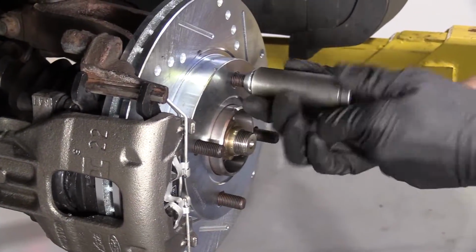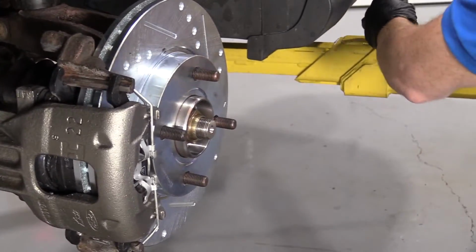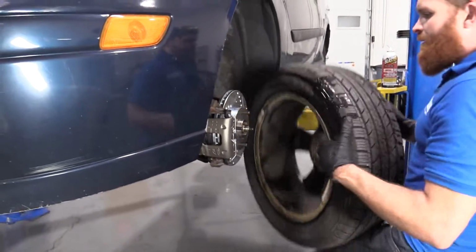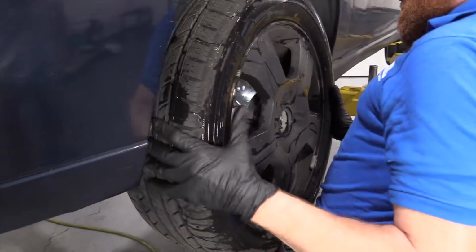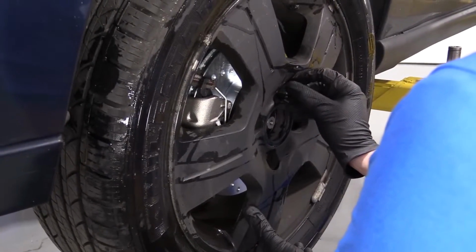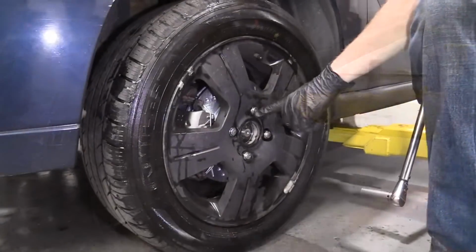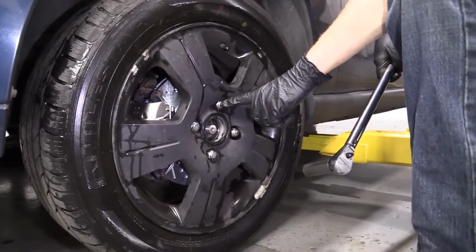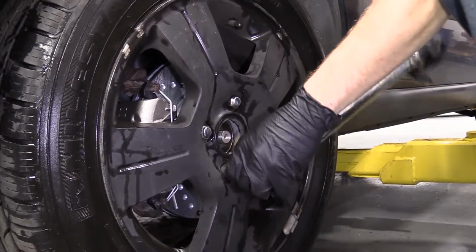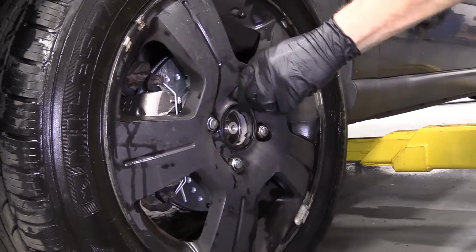Let's take off that stabilizing lug nut that we throw on there. Okay, we'll grab our wheel, bring it over. Just going to lift it right up with our leg. Use our ab muscles. Hold the wheel. Put our lug nut back on here. I'm going to grab the other 3. Time to go ahead and tighten up these lug nuts. 100 foot-pounds. We're going to go in a crisscross pattern, never around in a circle. Let's do it again.